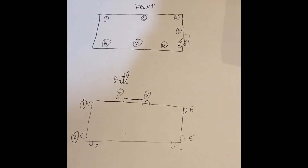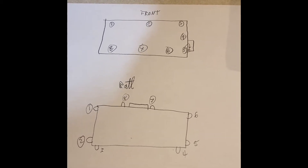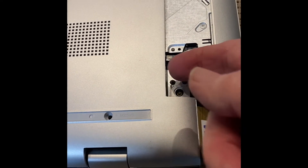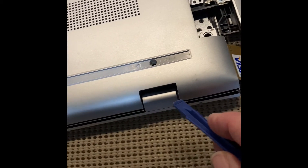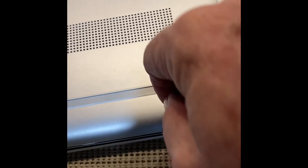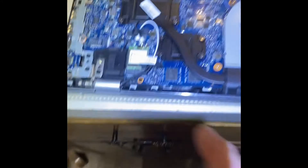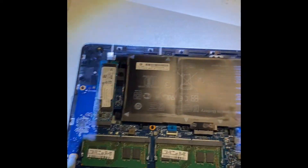I like to make a little pattern of where all the screws and case screws go, and as I pull them out I tape them to those positions so I can be sure to get them back in the right place, because they do vary in length. I started over here in the corner, lifted it up with a spudger tool, and stuck a piece of a credit card in there to hold it. Then I worked around, going in and up, pulling back to release the clips. After slowly working my way around starting here - this was very tight and didn't want to come apart - we got it all apart.